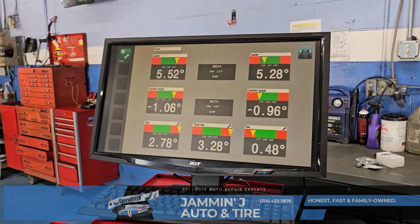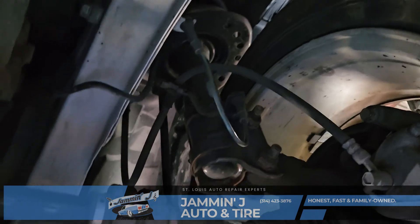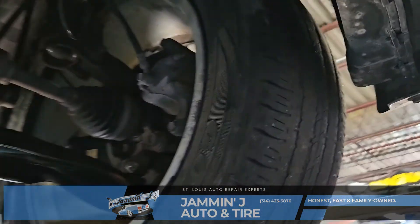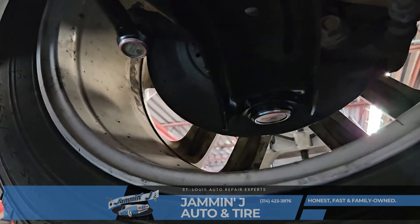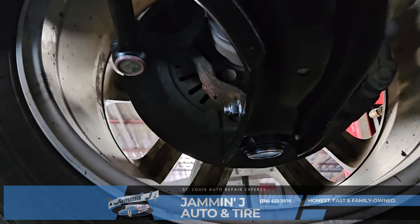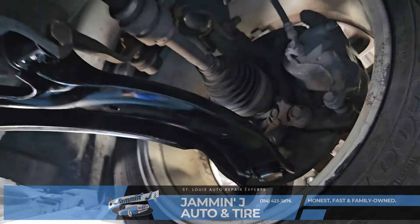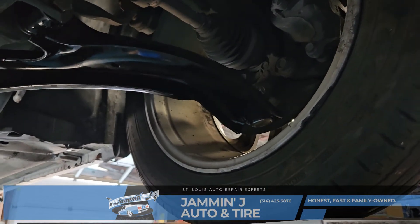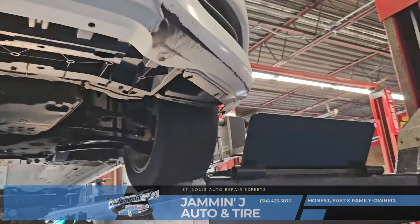The last angle is caster. Caster is also built into the geometry of the strut and is not adjustable on this car. Back in the older days, and maybe still on some newer ones, we could wallow out some holes to adjust caster. Caster is a difficult concept for most people — this is the lower control arm and ball joint, and the wheel rotates on that ball joint. It's the angle of that rotation: is the ball joint straight up and down, or is it kicked backward or forward? A good example: on a tricycle the front wheel is straight underneath you, but on a motorcycle with a long fork, the wheel is kicked way forward — that's the difference in caster. Anyway, that's what we do in an alignment: pull the car in, put the heads on it, and adjust the suspension the best we can.